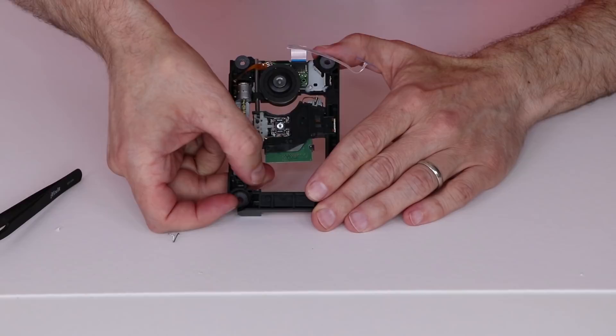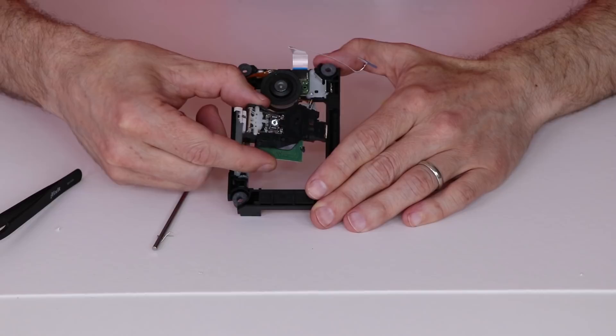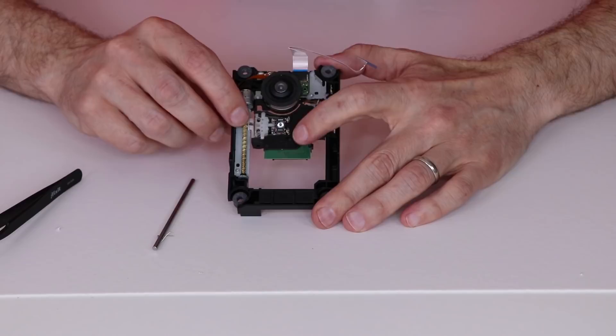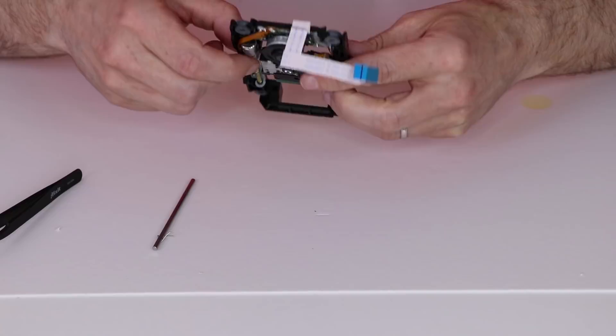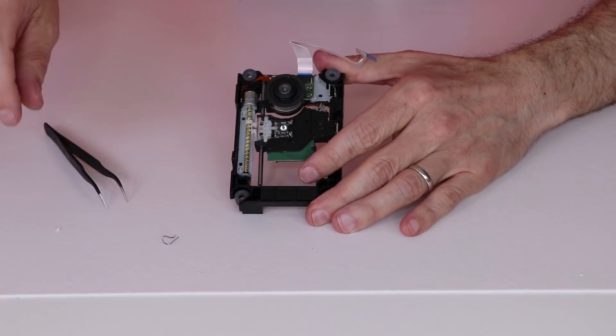Now that the adhesive is up out of the way, we can move the bar backward the rest of the way and pull it completely out. With the bar removed, we move the laser up and out, then install the new laser right onto the rail and back onto the worm gear. As with the other laser, you'll likely need to replace the white piece if getting a new laser. Once installed, put the bar back under the ribbon cable, line up all the holes, and slide it all the way through.